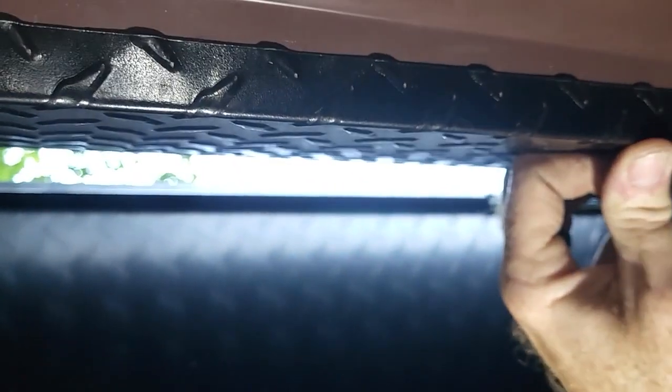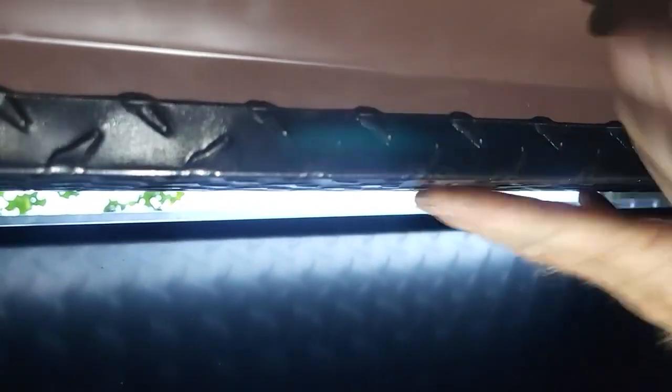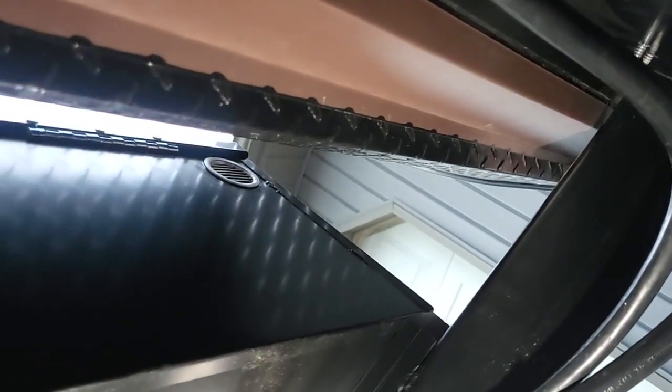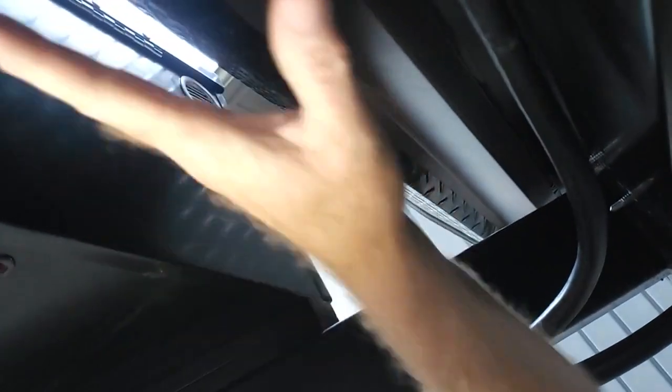So this is more just a general idea video. You can see there's quite a bit of flex in the diamond plate here and there's a piece of wood right behind this. I'm going to put an additional screw right here in the center to help pull this in. We've got good coverage down here on our floor now, clearance on our wires, the corners covered, and we were able to tuck that in underneath there. Now you can see we're solid — there's no flexible plastic, no house wrap that's exposed. We've got the corners here and we're going to seal those corners up really well. We don't want to create another problem by allowing water to get behind our protective piece. We're going to seal this edge once we get everything screwed back in place, seal the edges over the corners on both sides, and seal around the wires — the last thing you want is to create one problem while you're fixing another.